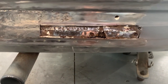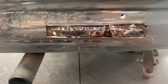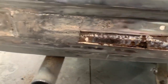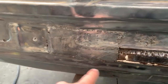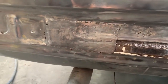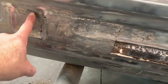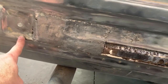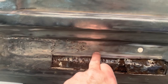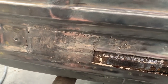I have cut that rusty piece out and I thought to myself that still looks pretty good, I'll start cleaning it up. It's very pitted, there's still a bit of steel there, but we've gone this far - let's just cut the whole lot out. I also thought I'd keep this previous patch panel, but that is rusty behind there, so let's just get rid of that too. We'll probably end up going all the way to about here because that still looks good there. We're all good up here till about here, so we'll cut that out there and along there and just replace the whole lot.